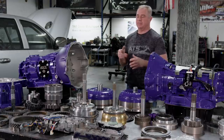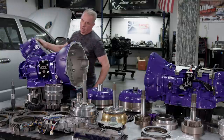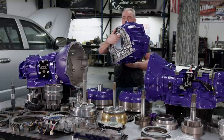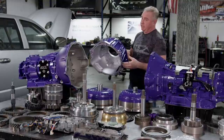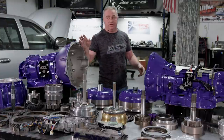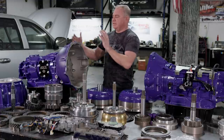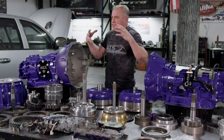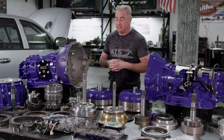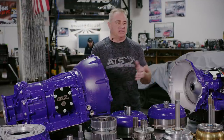So you're probably asking, 'It's a no-brainer — why wouldn't I just stick an Allison behind my Cummins?' Here's the problem: the Allison was never built with a bell housing that would fit your engine. There are two bell housings — the GM bell housing and an SAE bell housing. They did put the Allison behind Cummins motors in medium-duty vehicles, but it uses a big round bell house with a big long adapter plate. It's so large it doesn't really fit into a light-duty truck.